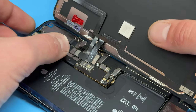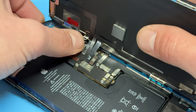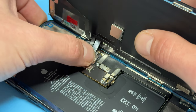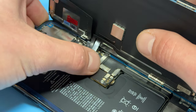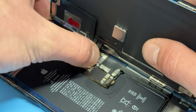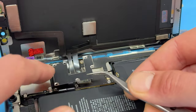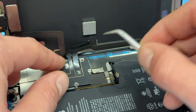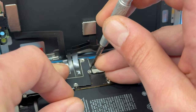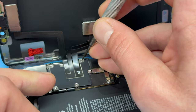Offer up the screen — I always start with the top left connector, line that up and the rest should follow fairly easily; you may have to wiggle it around a little. Make sure the connectors push in all the way, because if you get no image after turning it on, it's probably because it's not connected or you have a faulty screen. Be careful when putting the shield down as it can get stuck on the plastic film.